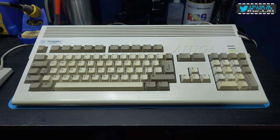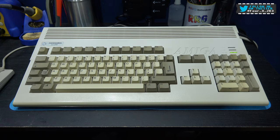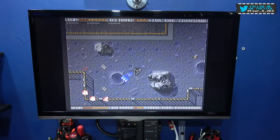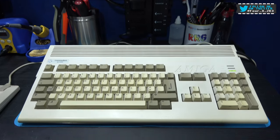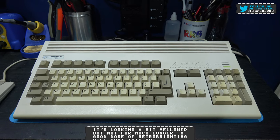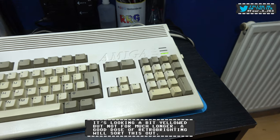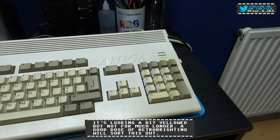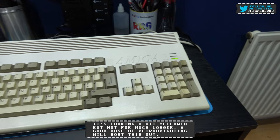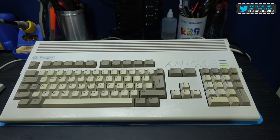What you're looking at in front of you is the Commodore Amiga 1200 I repaired in a previous video. As you can see, it's working perfectly fine now. It wasn't a tricky repair, it was just the phono had a dry joint on the left channel, so it was missing its left channel, and the floppy drive was really dirty inside, so it was failing to read games, but give it a clean and it fires straight back into life. If you want to watch that video, I'll put a link in the description.